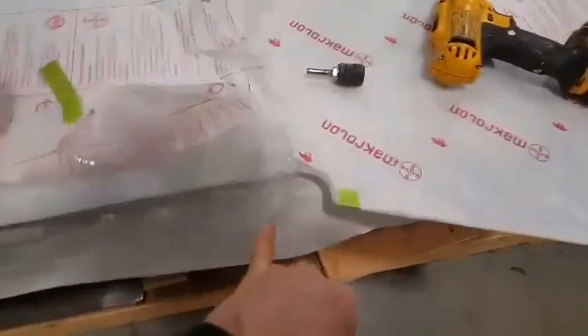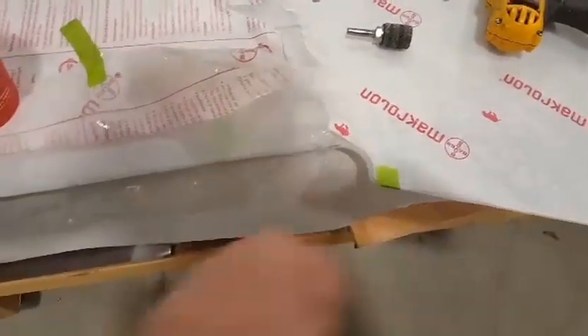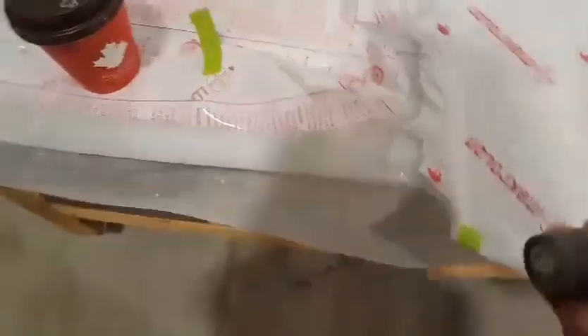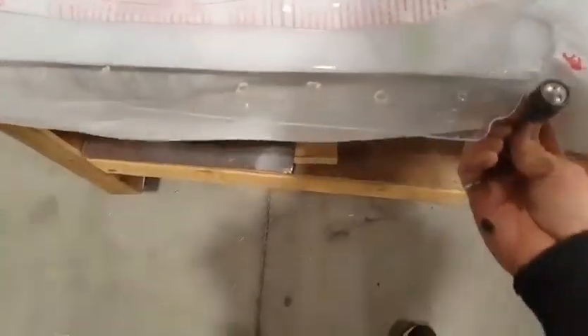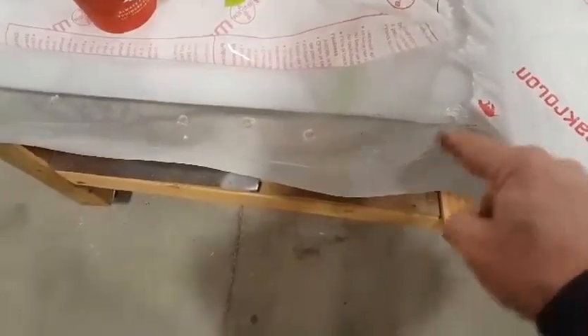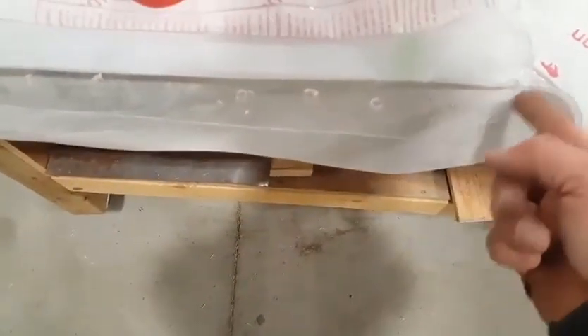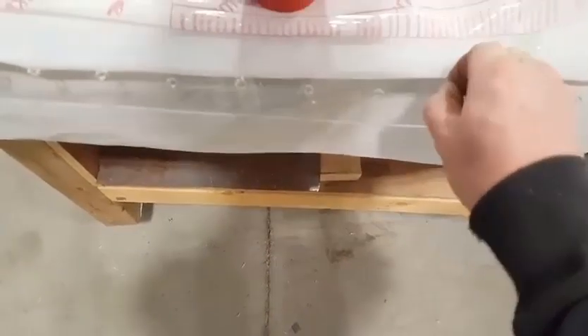The windshield's back off the airplane. I measured to make sure all the cutouts were right — around the spar and where the bolt for the front spar attach pin is. What I found really handy was an oversized Dremel-type tool you stick in a drill. I rounded off all the edges — I cut this initially with a one-inch hole saw, then went around with sandpaper, beveling all the edges to take off any nicks and stress risers. I'm also using a deburring tool on my drill, going top and bottom on the holes, taking the burrs off to remove stress risers.